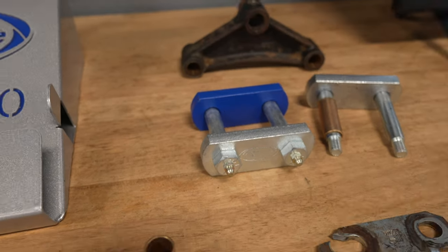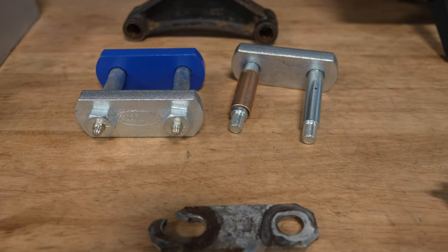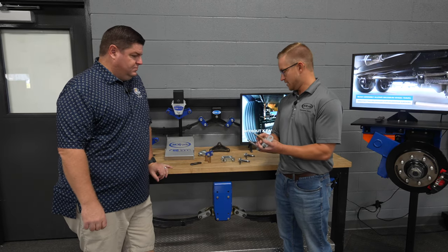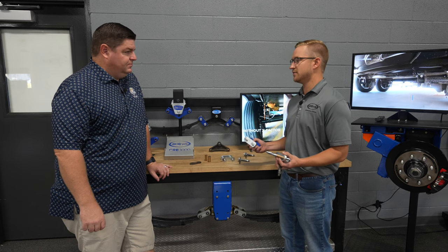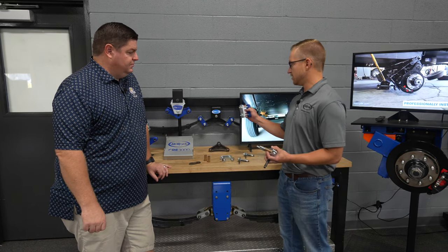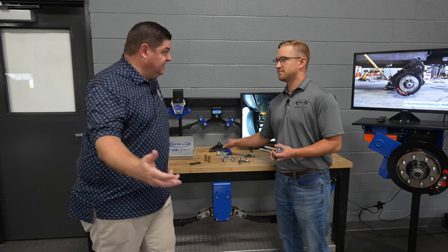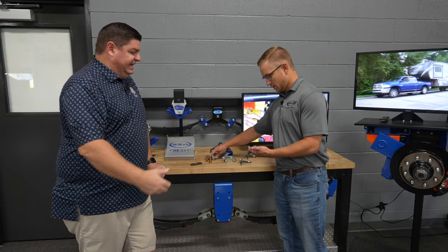With ours, they're half-inch, so it's quite literally twice as thick. Instead of plastic bushings, we're using steel bushings or copper bushings, and instead of a dry bolt, we're using a wet bolt. That's the biggest advantage to our system, just on the shackle side. Just because we try to explain things simply, what does it actually mean when you say wet bolt?